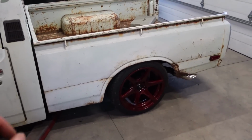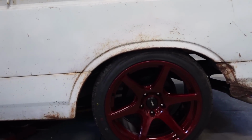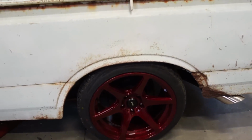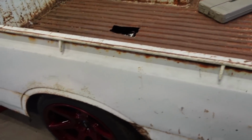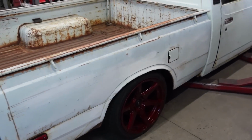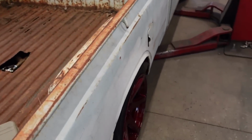We are back on the ground. These coilovers are as low as they will go, and that's not quite low enough. Now, I'm not worried about that because these springs are going to settle. All springs settle quite a bit, actually, from when they're brand new. So eventually that will probably drop down. I'd guess another half inch. So that's right about where I want it.